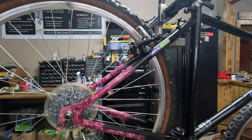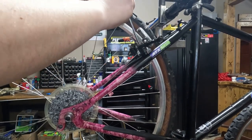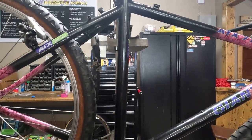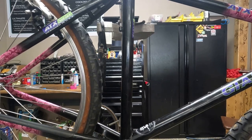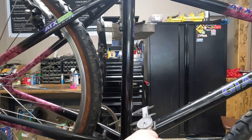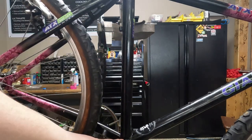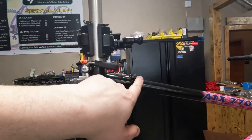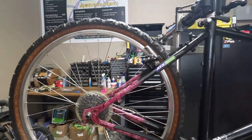Still need to take the pie plate off this rear wheel, because we can't be riding around with the pie plate. So now we need to measure — I believe it's 31.8. We're gonna measure the frame here. Yep, 31.8. So we need a 31.8 Deore LX top-pull front derailleur. Top pull because we have the cable stop right there — everything comes across on the top tube. And then we need a rear derailleur, so let's go grab some black Deore LX derailleurs.